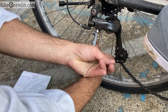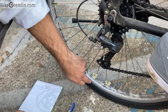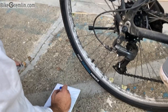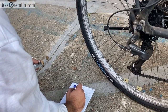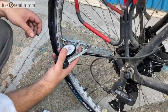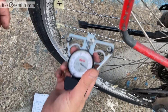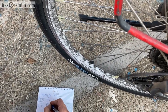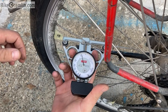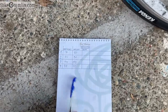The left hand side spoke is just under 60 kilogram-force. It hasn't lost any tension — it's a bit away from the contact point so that's expected. It even gained a small amount of tension; let's call it 58 kilogram-force. The third spoke is about 110 kilogram-force, so that's the same. And the fourth is still under 60, about 55 kilogram-force — so those two have not changed.